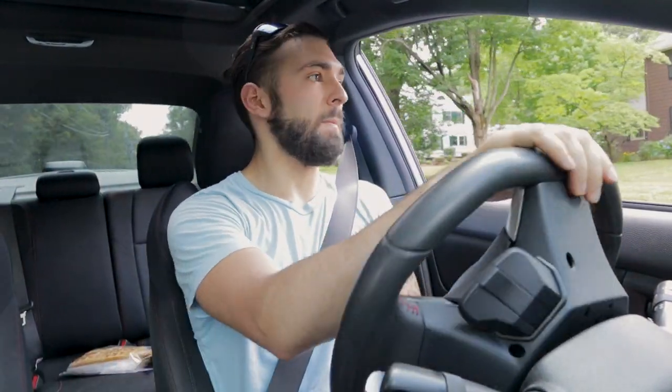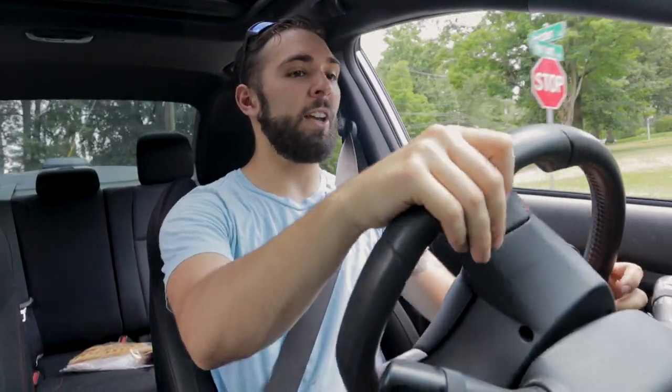The biggest benefits you're going to see between the WRX and the STI brake system are with the upgraded rotor size and the swept rotors I have now, the symmetrically vaned rotors. All of those aspects are going to help with reducing brake fade over time on the track when you're really beating on the car and hitting the brakes hard. But that being said, the stopping power is definitely there even when you're just stopping normally or in an emergency situation. I did bed the brakes, but just for a second, about 35 to 40 miles an hour. Just smoother, so much sharper, feels really good.